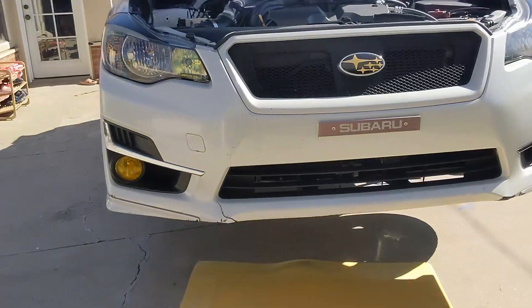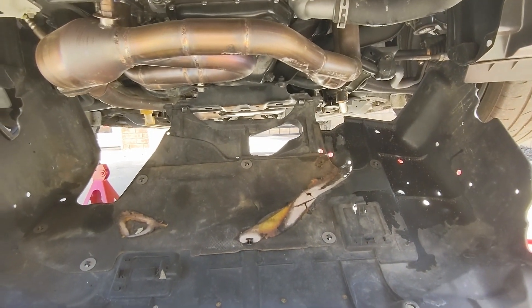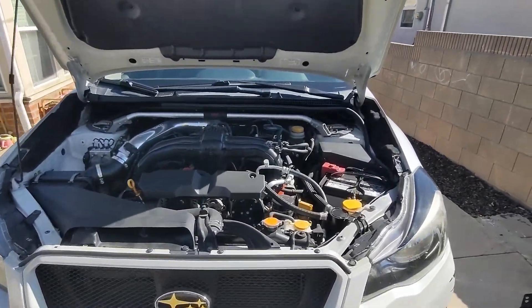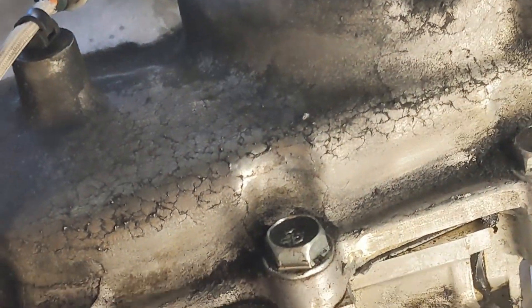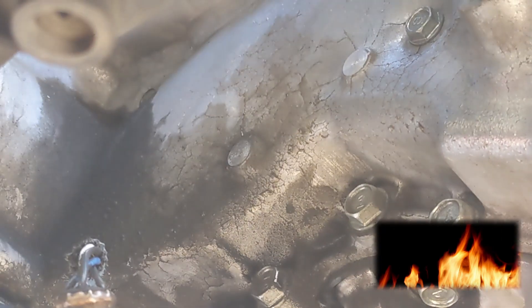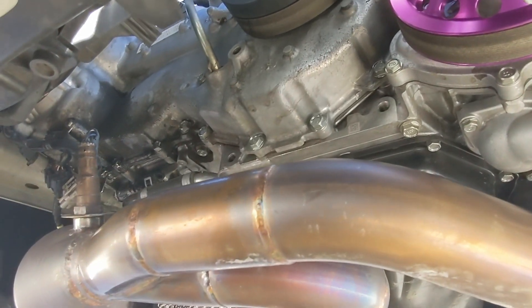As some of you know, I have an aftermarket header which is really, really hot and it burns things. I also have a minor timing cover leak — on that side I think it's a cam carrier or timing cover weep. I drive this car pretty hard, but there are issues that can arise. There's a timing cover over there — I cleaned it up a little bit — but you'll notice cracking here, and over here, and over here as well. So what is that? That's cracking.